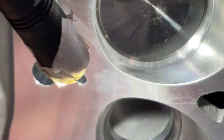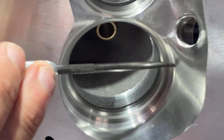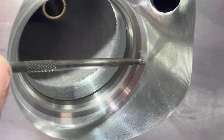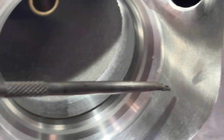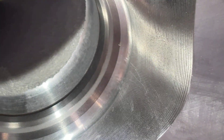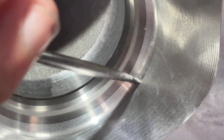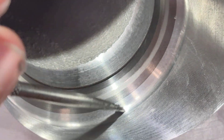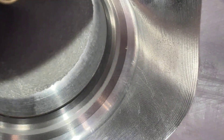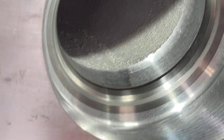Here's another thing that's pretty interesting. It's got this nasty step right above the seat as it's supposed to go towards the chamber. That seems like a CNC programming issue. Maybe they don't all have this ugly step, but it just doesn't make sense how that gets allowed.